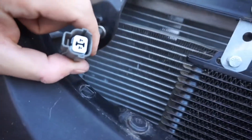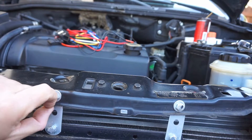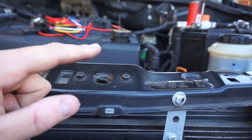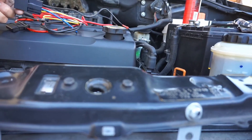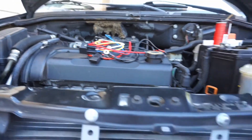I learned this lesson installing a Wolo horn where the instructions said plug-and-play, but I had to install a relay and supply 12 volts. Before doing that correctly on my 300ZX, I'd only be able to press the horn for about two seconds before a fuse popped. Once you supply enough current it's fine, but always install a relay when putting in aftermarket horns.